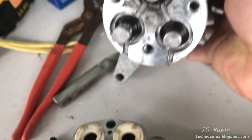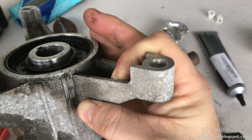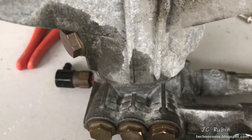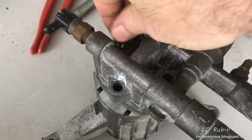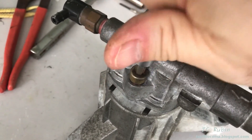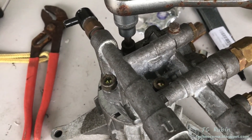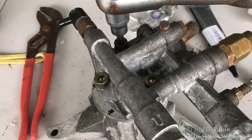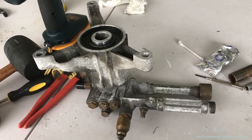Because these white pieces could fall right out, I'm going to keep this laying down and lower the pump over it, then situate and seat everything down. I'm going to drop the three screws through on the other side as I hold this together. I've got it sitting upright now, just turning in a screw all the way so it doesn't fall apart, hand tightening them. It's aluminum, so I snug each bolt progressively, one at a time, making it tighter and tighter until they were nice and snug, but I didn't try to break anything. This is just a water pump — if anything, I can always tighten it, but there's no need to snap anything. And now it is already brand new for assembly, back into the unit.